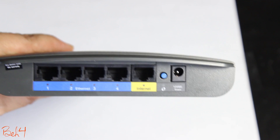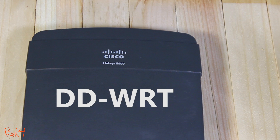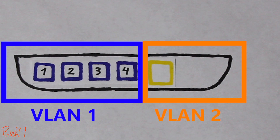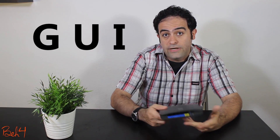Unfortunately, the stock firmware on this wireless router doesn't let me make this change. The good news is, if I install a third-party firmware such as DD-WRT or Tomato, then I should be able to make this change. But before I start, I want to mention that in the DD-WRT firmware, even though the web interface gives me the option to add and change VLANs, for some reason it doesn't seem to work correctly. If I want to make sure it works, I should do it in the command line interface, not the graphical user interface.